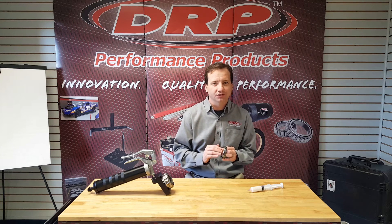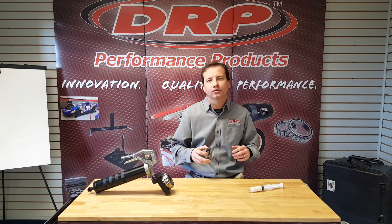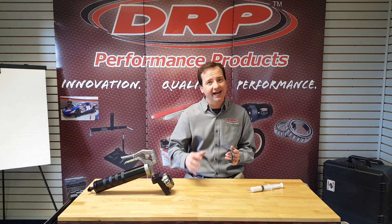Commonly these bearings are over packed. We never want to pack a racing bearing more than 50% full, so that means no more than half full of grease, and that's a max point. The difference between a racing bearing and a typical automotive bearing that you may pack completely full is that a racing bearing turns at a lot higher RPM and it gets there really fast, so it generates a lot of temperature really fast.